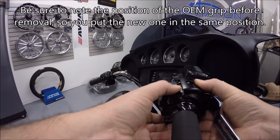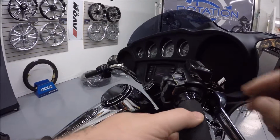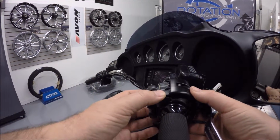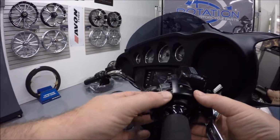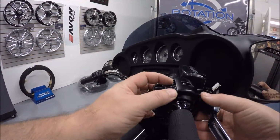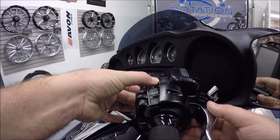Pull these back apart a little bit. And there we go. So just make sure everything is correct in here. Make sure it's slid on all the way. And I'll go ahead and reassemble this. Just remember not to over tighten these screws as well. They just need to be snugged up. We're going to put the housing back on first, the cover, tighten those two up, and then we'll get everything lined back up here and retighten the two that hold on the master cylinder.